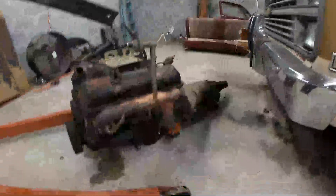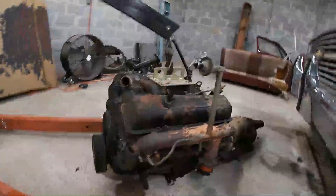The truck drove in here so we already know we're doing all right. Transmission fluid was bright red and looked great. I'm probably going to put a pan gasket on the transmission too, because even though I tried to prevent it, I dumped about six quarts of transmission fluid on the floor out of the tail shaft. Once you get it up in the air and it starts leaking, you just kind of stand there, laugh, and let it go. Next step is taking the transmission off the engine, getting this thing on an engine stand, getting it cleaned up, and we'll get the truck cleaned up. Motors out of the donor truck - stay tuned.